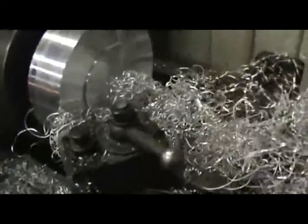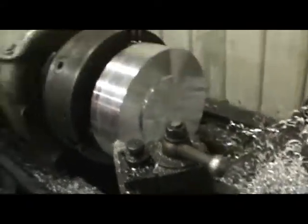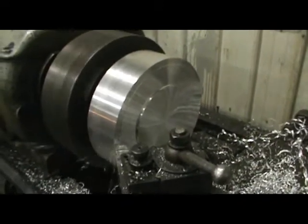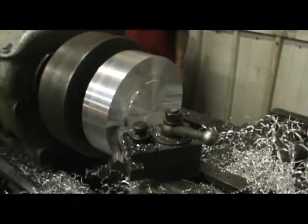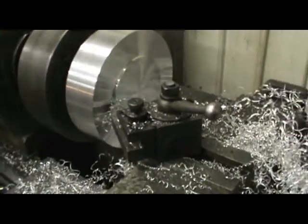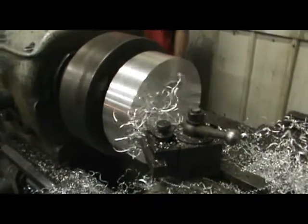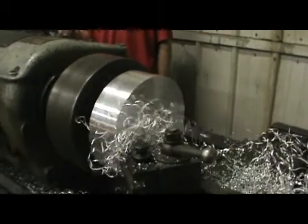We're developing a little bit of aluminum shavings. They're actually coming off nice and hot. I'm about 135 thousandths down. I need to go 200 thousandths down. We'll get a shot here. We have to do it manually. Not quite as messy when I come back the other way. Nice little spirals. I'll shut it down here and take a measurement of it next.